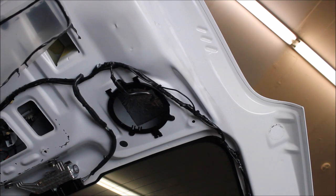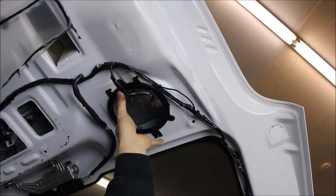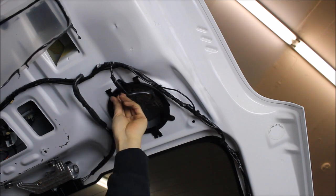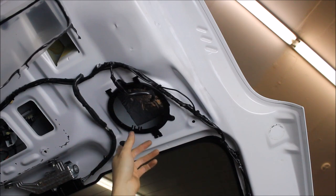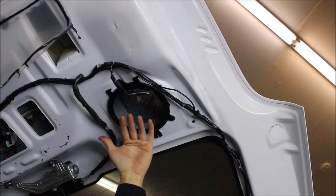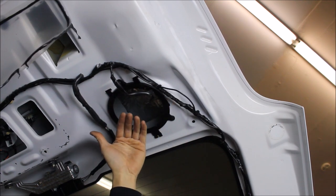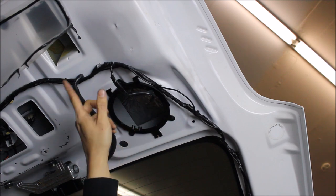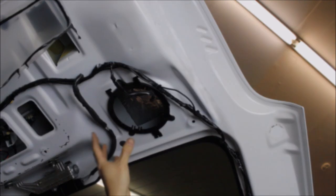This is an issue in a lot of vehicles nowadays. We got lucky with this one because it has a round hole but the diameter is too big for the speaker to mount to, so we have to put this adapter plate. You might come across vehicles where they have really odd shapes and angles because they are trying to get more mid-range bass into the door. If you just mount the speaker flat it is not going to come out towards the door panel and you are going to get a lot of mid-range bass trapped in there. These speaker adapters are going to make your life a lot easier.